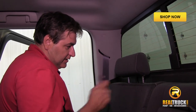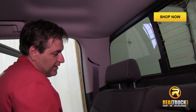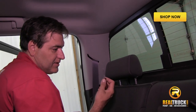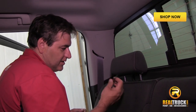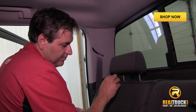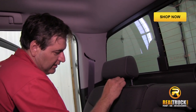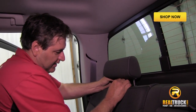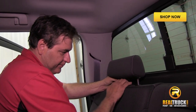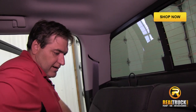It's really an easy process to remove the headrest. All you need is some type of a little pick or something like this. Right in the bottoms of the places where the headrests slide into, there's a couple of holes in there. You just push in on that, and that will allow the headrest to slide up — just like that — and you can just pull it right out of there.